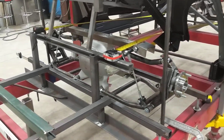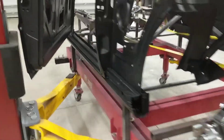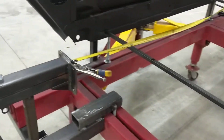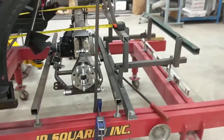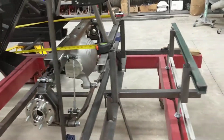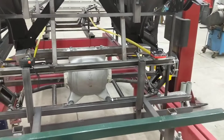Once I got the thing placed properly, I ran two tape measures that go to the front of the car. There's nobody here to hold them, so I used clamps to hold them in place to measure the distance from my front clip going to the back of the car — you can see right there. When I pulled them tight, I was accurate to within a sixteenth of an inch.